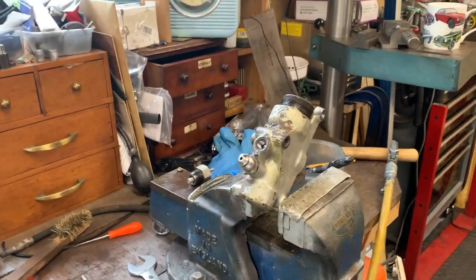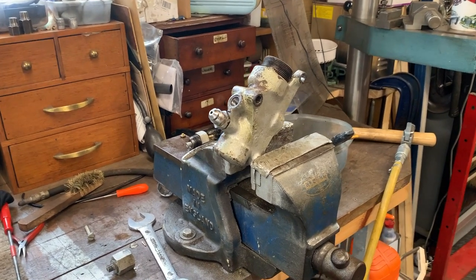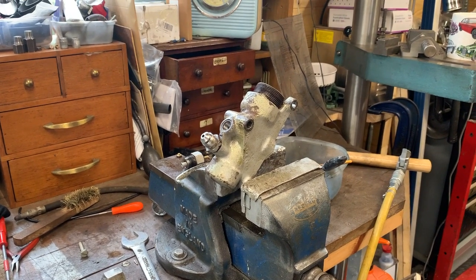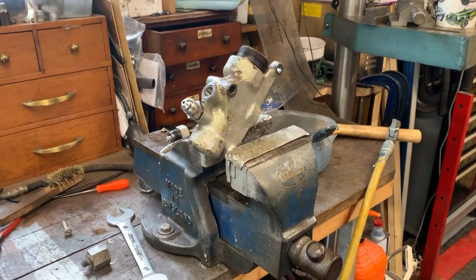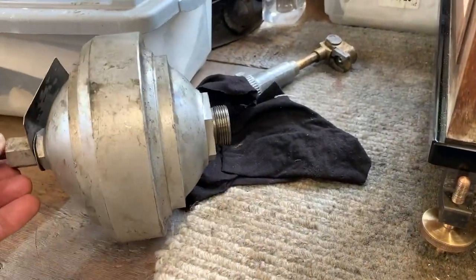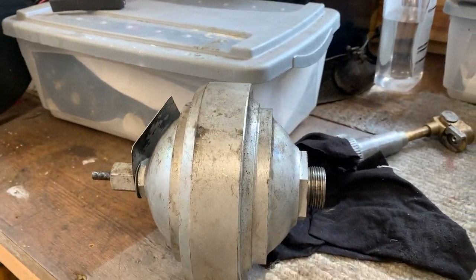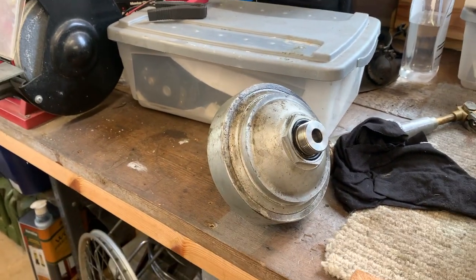If I've only got four or five pumps on the accumulator when the engine switches off, then there's definitely going to be an issue somewhere — either the spring inside here is no good, or the accumulator itself is no good. Interestingly, when I looked from under the car this didn't look that old, and now I've taken it off it actually doesn't look that old either.